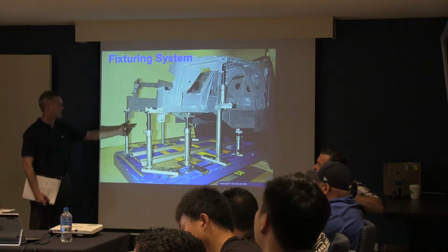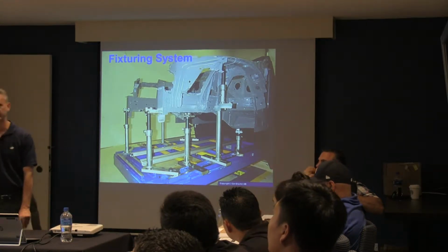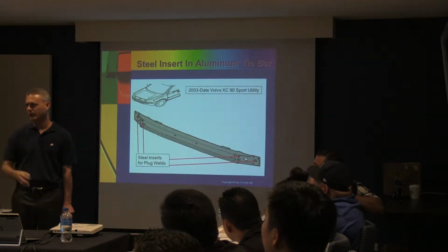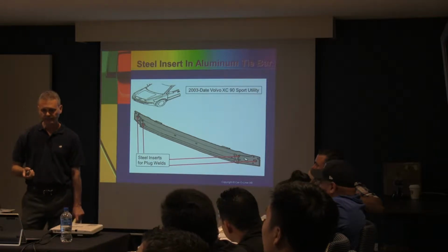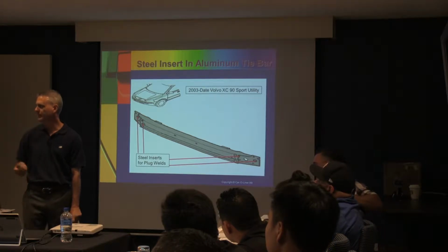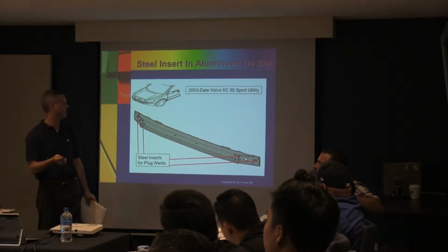And when the tolerance goes away, I think you're going to start seeing everybody go to fixtures, by the way, because fixtures force you to put the car back to square, right? So I know Spanesi's already switched over to fixture, Celette fixture. I don't think Chief will ever change, and I don't know what Car-O-Liner's going to do, right? Car-O-Liner's on fixture? Yeah. I wouldn't be shocked, because right now they spend an ass load of money making clamps everywhere. And if they go to fixture, it's not going to be near as much of a deal.